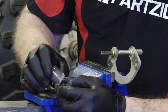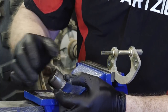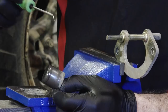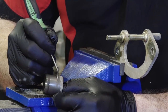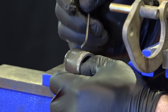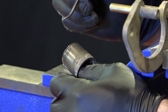I think I was right. It's got two seals inside there — the inner one, and then the outer one that's supposed to be keeping the dirt out. I can see that it's got some buildup right where that outer seal would be. So I'm betting that's what was causing it to kind of stick in there and not retract just a tick once the pressure was taken off of it.